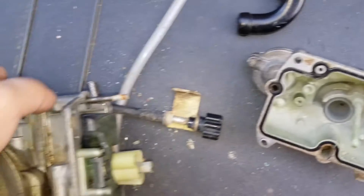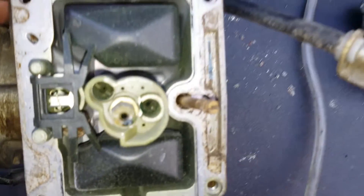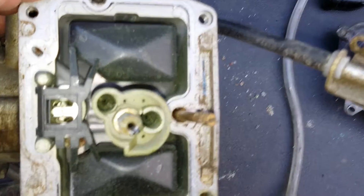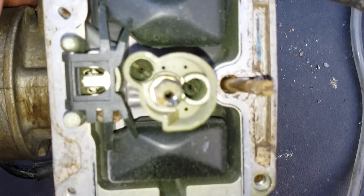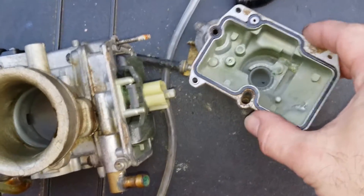It's not like the old days when you'd put petrol in and everything would stay nice and clean. Nowadays, put petrol into your engines and it'll rot the inside of your carburetors out. You're going to find this on all carburetors — they're just not designed for this type of fuel, unfortunately.